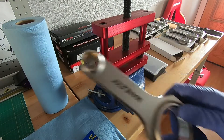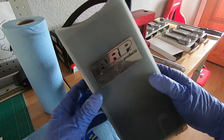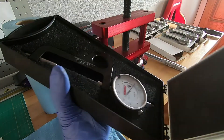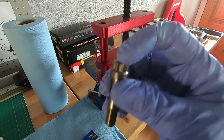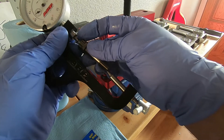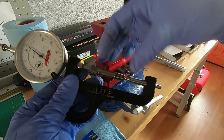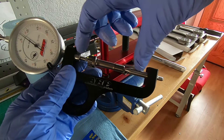First, I'm going to go ahead and remove one of these bolts. To measure the bolt I have this ARP bolt stretch gauge, part number 100-9942. On this rod bolt it's got a dimple on the top and a dimple on the bottom. You put the gauge in there and it measures the bolt at its resting point. Then when you torque it down, the bolt's going to stretch out and the gauge will tell you how far it's stretching.